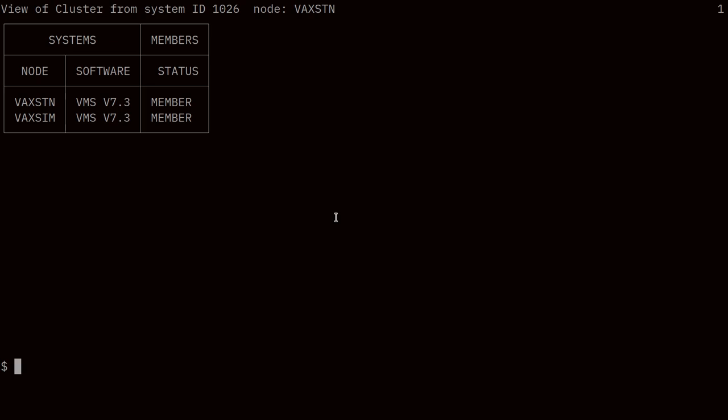I've set up a lot of Linux systems to netboot. I've set up SGI IRIX systems to netboot to do the install over the network. And it's not exactly rocket science, but having to mess around with a BootP server and a TFTP server to send the initial network boot image across, there's just a lot of manual steps to make that work. And I always mess something up initially and have to troubleshoot and debug it. Maybe if I did it even more often, I'd be better at it.